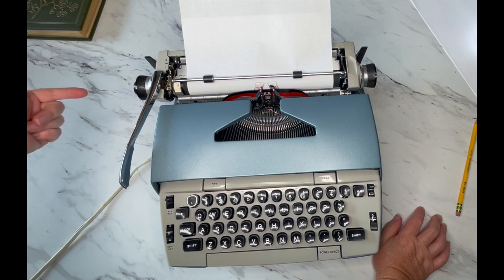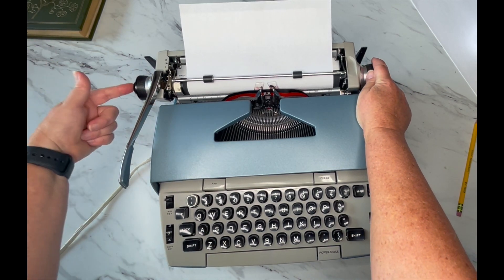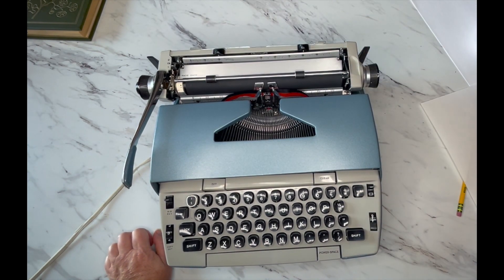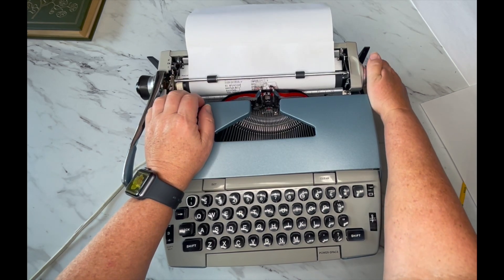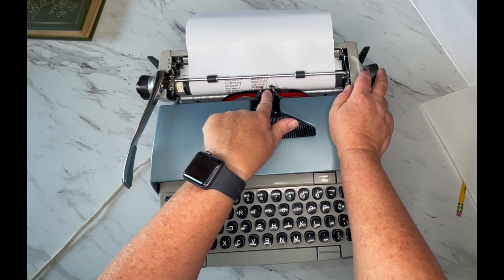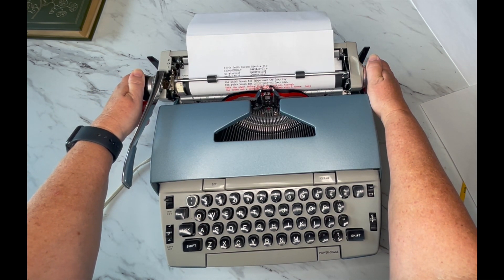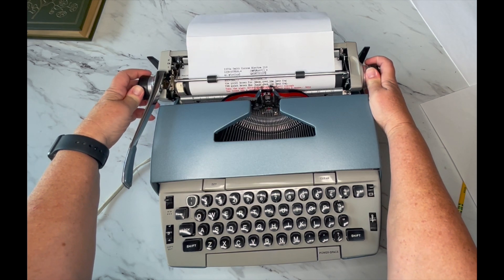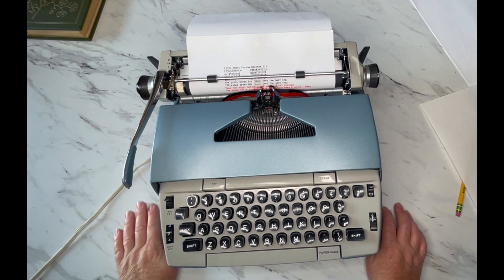On the left side is a button. You'll notice it's not on the right side — look at these handles and you'll see this black thing sticking out. That's actually a button, and the best way to explain it is to show you. It releases your roller, which is also called the platen. So let's say you're trying to line up something — if I wanted to keep typing on this line and it's a bit off, turning the handle is going to advance a half line. But if I press this button and turn at the same time, I can line it up just right.